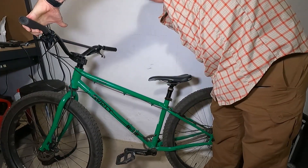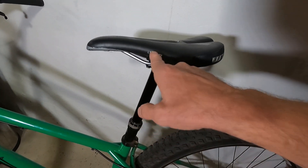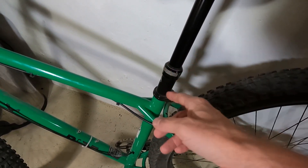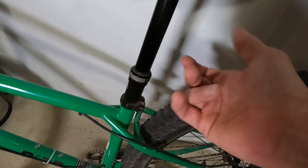At the beginning of this video I would push the lever and nothing would happen — now it shoots up like a dream. So if your dropper post starts getting a little funky, not going up all the way or it's really slow, it's more than likely the air. You have to take the seat mechanism off to get at that valve — that'll fix it. If that doesn't fix it, something else is wrong: probably the cable slipped or came loose, or the internals of the post have gone bad and need to be rebuilt — maybe the seals wore out and air just seeps out.